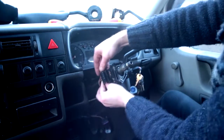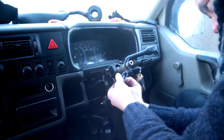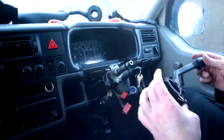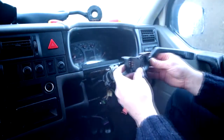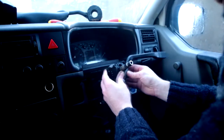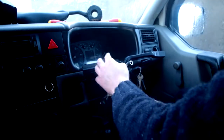Okay, there's four electrical connectors on the back of this. Two on the left and two on the right. They're a bit fiddly to get off, but once you do, they're handy enough to get back on. So, out the old part. Full of grease in the middle. This is why it was causing it to short. The new bit goes on, a little bit of pressure, and it sits on quite neatly.